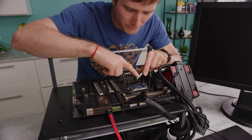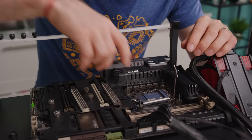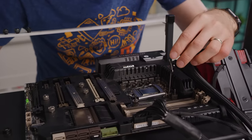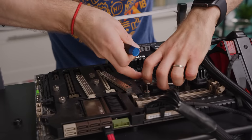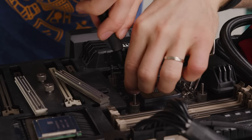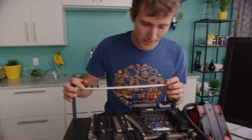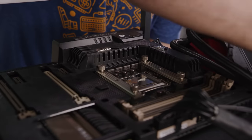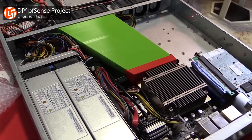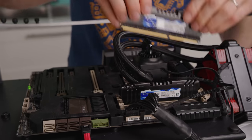On a typical Intel LGA 115X CPU, you've got these little tabs to push the CPU down into the socket and make sure the pads are making good contact with the pins. Well, it's too thick because you've effectively got two substrates' worth here. Oh crap, it's coming out of the socket — if it falls back in, that socket's probably dead. So we're going to throw a little washer in here as a spacer, and hopefully we'll be able to install it properly. Mobile CPU, desktop motherboard. Be very careful not to mount your CPU with too much pressure. This is Z87, so we're going to be using DDR3 memory, and we've had really good luck with these G.Skill Ripjaws kits.